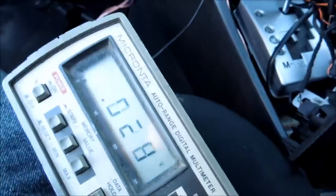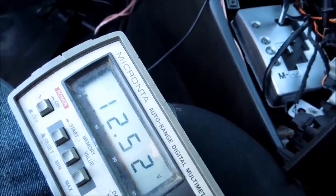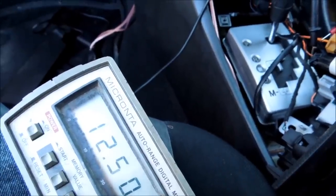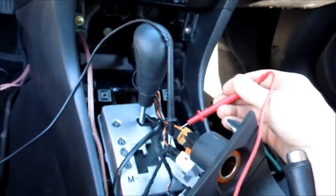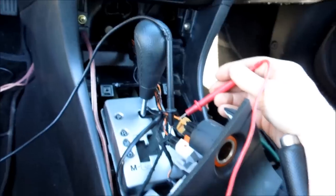Watch this — see how it's zero right now? If I touch my probe on here, it says I'm giving 12 volts. Now if that shows with a little minus sign and 12 volts, it means you've got your probes backwards, meaning that this one is actually the positive wire — you're touching it in reverse.